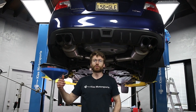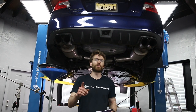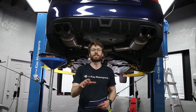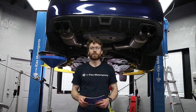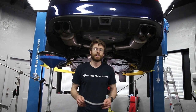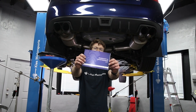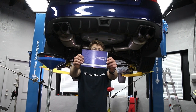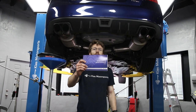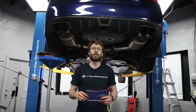We're working on my brother's 2016 WRX and doing the front and rear differential fluid changes. The one really nice thing is that the front differential shares the fluid with the transmission since he has the standard or manual transmission, so you just have one fill plug and one drain plug. That makes it really convenient. The maintenance schedule is in your warranties and maintenance booklet — not in the owner's manual. They recommend changing it every 30,000 miles or 48,000 kilometers.